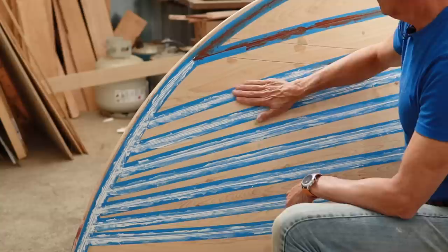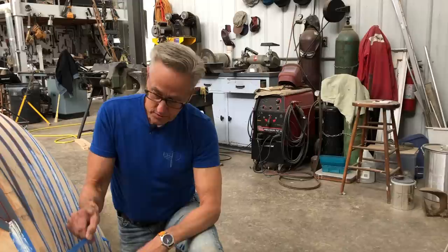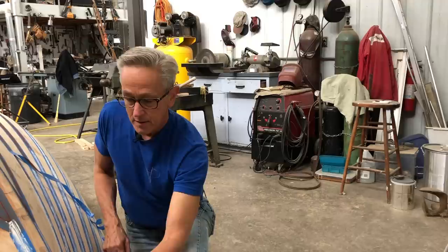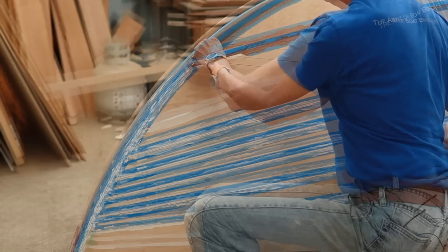It's been 48 hours or more since I put this seam compound in. You can see that it's really pretty dry — it doesn't come off on my hand at all. One of the things I had read is that some of the complaints was that this seam compound, the white, never sets up. That's just a case of not waiting long enough. It does skin over, and as you can see, in 48 hours it's skinned over very well. It's also been pretty cool here — gotten down well into the 40s overnight. Anyway, I'm pretty happy the way that's come out. We're not going to see a big difference here because, remember, these seams are painted with primer. So the primer is what we see here that's white, but on close inspection those seams look really good.